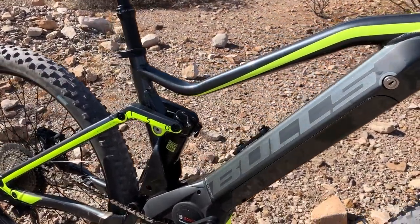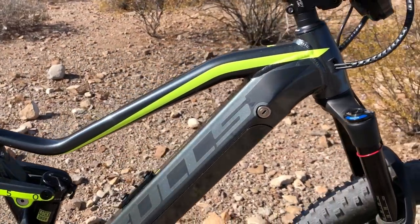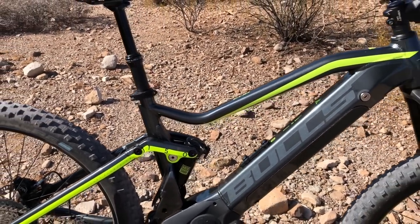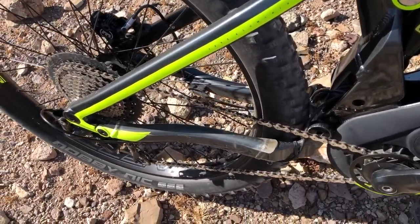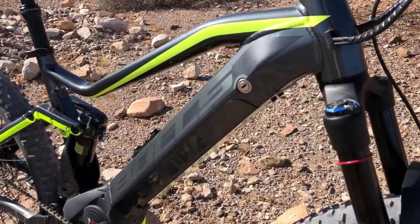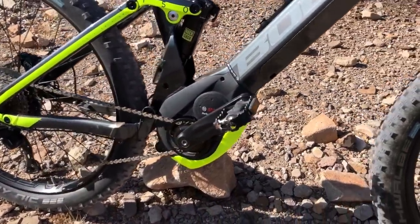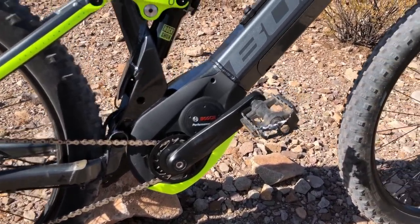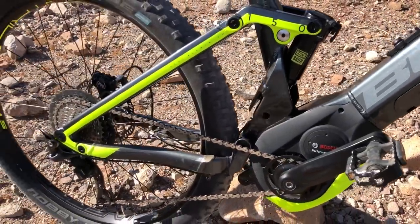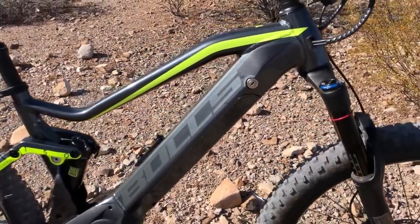First, let's look at the aluminum frame. The AM3 uses a lot of hydroform tubing — all sorts of different tubing shapes and sizes — molded to fit you as the rider, providing good standover clearance at the top tube. Down at the chainstays, they're brought in to give good heel clearance. The Bosch PowerTube 500 battery is integrated within the frame for a very clean look, and the CX motor is angled to line up with the down tube. The suspension pierces through the seat tube area to provide shorter chainstays for a nice climbing bike with good rear wheel traction.